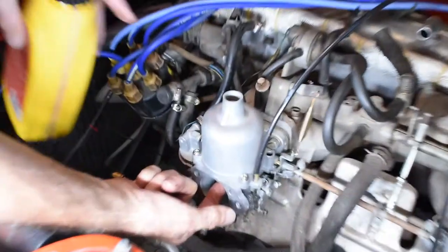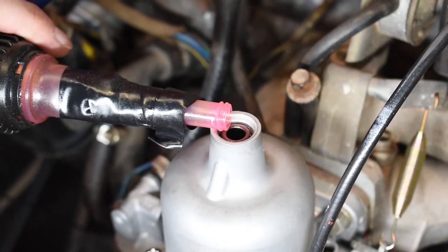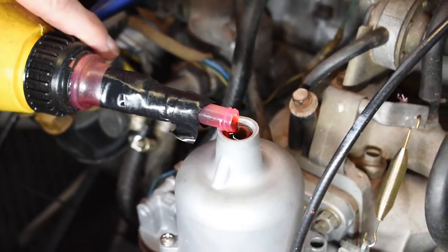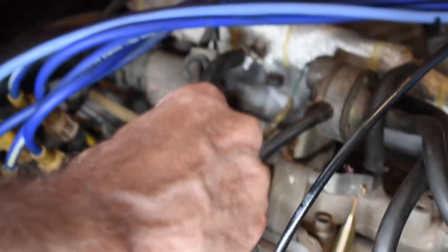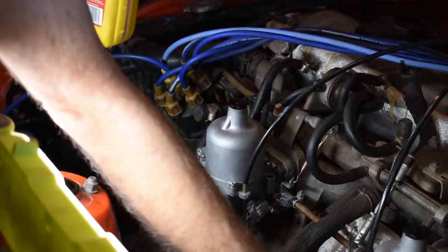Just lift the piston and fill the oil to the top of the damper, or you can be about a centimetre off the top. Any excess isn't really a big problem, as it'll just overflow down the sides and be burnt off by the motor when you first start her up. With oil in both the dampers and our jets set, we're ready to start up and start tuning.